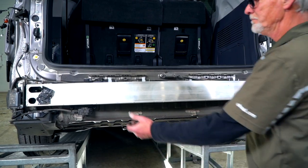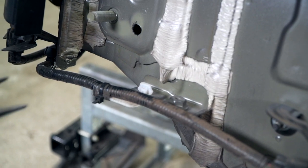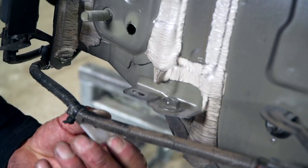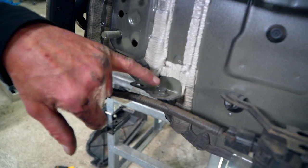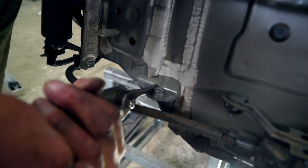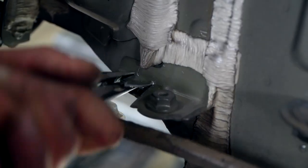Next, pull out on the bumper beam — this will not be reinstalled. After the bumper beam removal, we'll have to remove this attachment point for this harness. Using a pair of needle nose pliers, pinch it together and pull down. Now we need to cut this tab, leaving the weld nut in place, with a pair of tin snips. We'll cut straight back right along this line. Next, we'll use a pair of needle nose pliers and bend this tab until it breaks off.